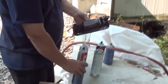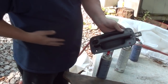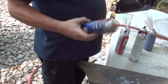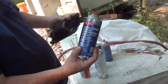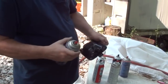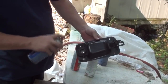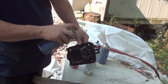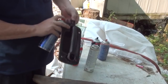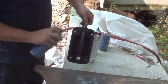I cleaned this up with some Windex and some Q-tips. These plastic parts — when they age, they start to crumble and stuff. So I'm going to put some of this electric shield on it. It's just a corrosion inhibitor, sort of a waxy type coating once it dries. I'm just going to dust it down so that it has something to help keep the plastic from dry rotting since I have it all apart — it's old already anyway. Give it a light coat. Maybe it'll help against the elements.